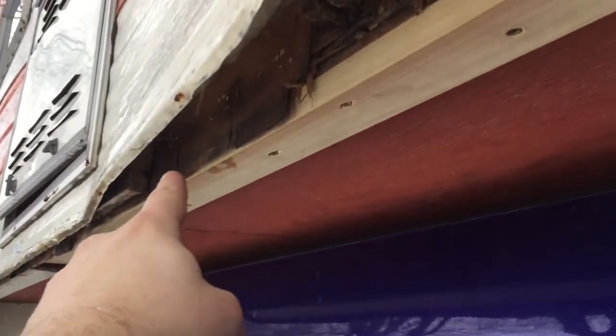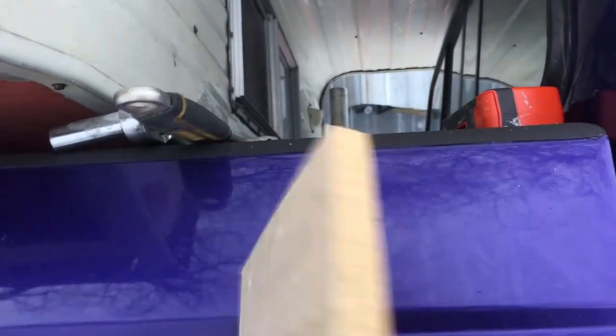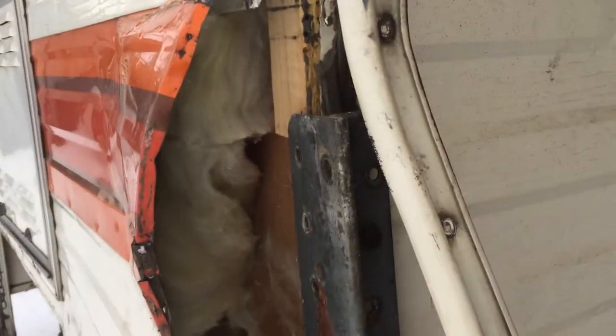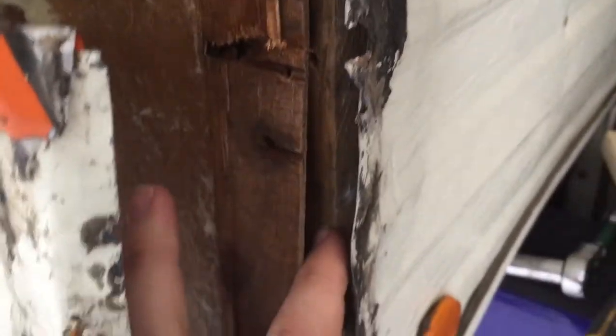I'm halfway through repairing it now. I've got a few pieces of hardwood on the bottom here to reinforce it, and I'm going to stick another piece up in this gap here. I pre-drilled it because it's hardwood — I don't want to split it. This piece is going to go up in here and fill that gap. Once I get this all back together, there's an angle bracket that'll go on the corner of the camper — that's what the jack gets bolted to. I'm just reinforcing this corner so it has something solid to bolt to. The wood frame behind here is still solid, not rotten.